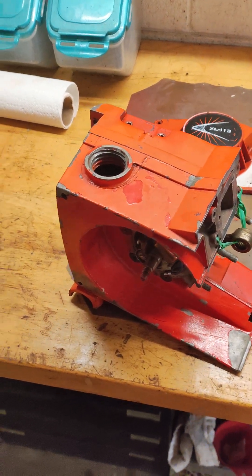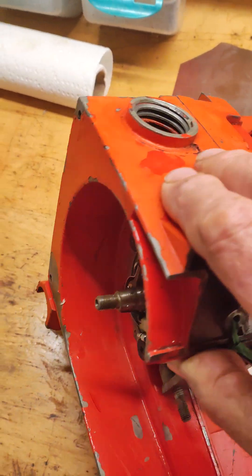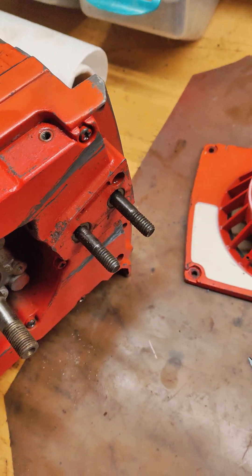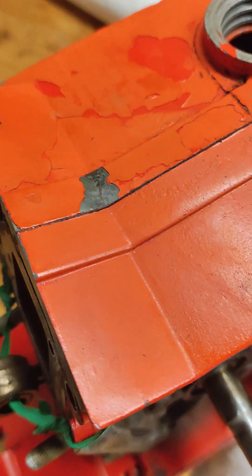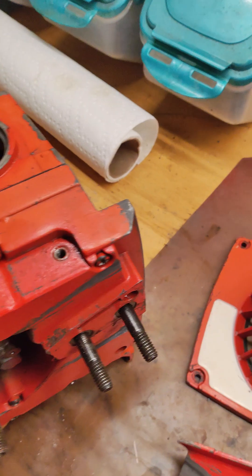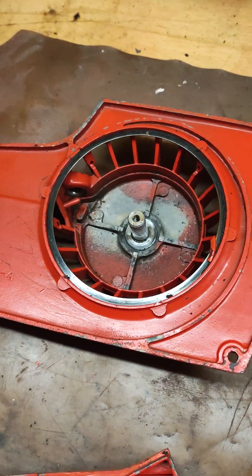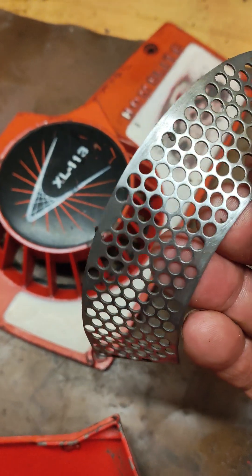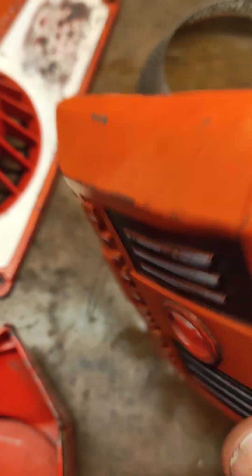The cleaning process is done. I'm leaving this on — I'm not going to split this case or pull that out, I'll mask that off. Now I've got to fix this scar here, that scar here, and that one down here with some JB Weld. After I'm done cleaning this saw up, I'm going to take some aircraft stripper and sandpaper and strip it down. I had to disassemble the complete starter. They have four little studs that hold this on. I've still got some polishing work to do, but this isn't goobered up so I'll be able to take the paint off and make it look pretty good.